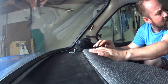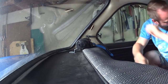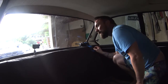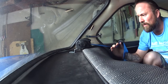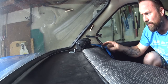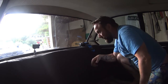You can see that this bracket is almost perfect to clear this seat. For now, it'll be a great way to try it out and see how that feels for anybody using this seat belt. The nice thing from Securon too is there are two slots of height that this reel can come in and out. For now, that's good. I'm going to grab a wrench, take a break for a minute because it is hot in the car, then I'll throw the rest in.